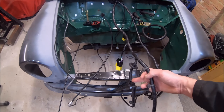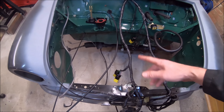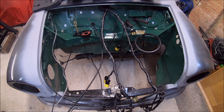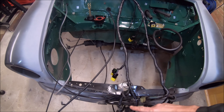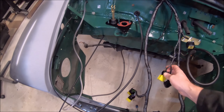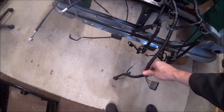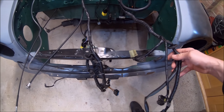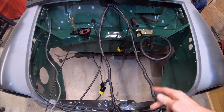So this wiring loom — which is not the full wiring loom, that's just like the engine bay loom — there's still a loom that connects here for the engine sensors and associated wiring. That still needs to go in and be cleaned up yet, but this loom I've recovered it all. I've taken all the plugs apart, cleaned up all the connectors, made sure everything's tickety-boo. It looks much better, much tidier now and I know I'm not going to have any problems with the loom. So that's ready to go in.